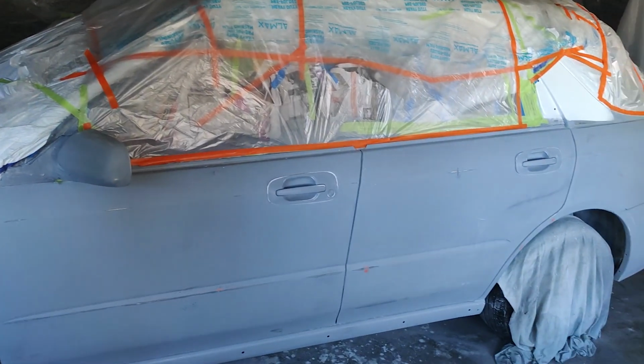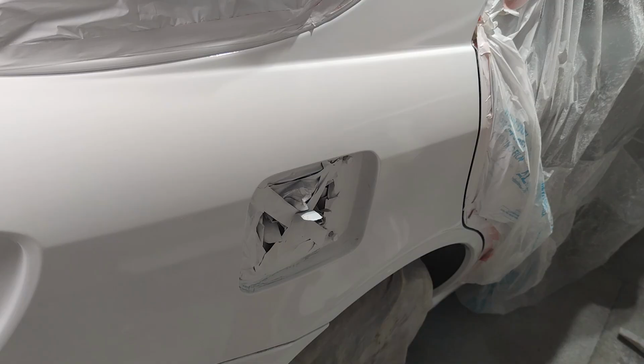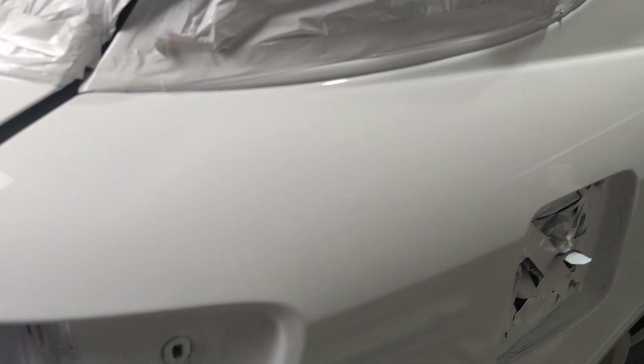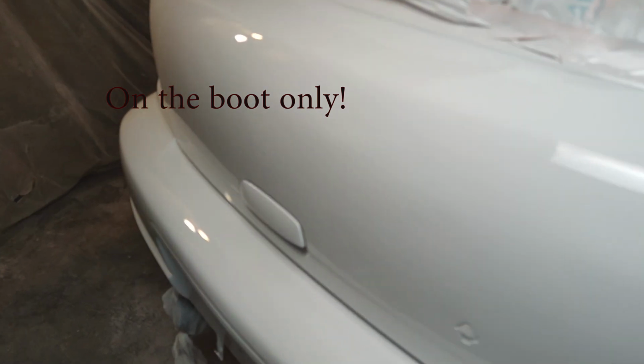And now the passenger side is prepped and ready to paint. And I'm pretty pleased with the result. Kind of weird too, looks like a moth the size of Israel landed on it, frolicked around a bit and took off. And I made the deliberate mistake of not primering over the body filler, and it made some pinholes. Now that I've made that deliberate mistake, now I'll learn from it.